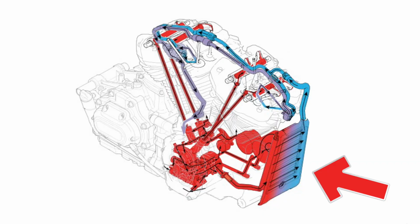I did want to find a better cooler, and a lot of guys are going to say, well, there's an oil cooler on there, so why would you go through an additional effort? In my opinion, it's a little bit misleading that the motor is said to be oil cooled, when it's really passive cooling. When you're up to speed, it's running air through that radiator and it's working. It is cooling that oil off, but the problem is there's no fan on it. So when you get down to low speeds, that radiator becomes almost useless.